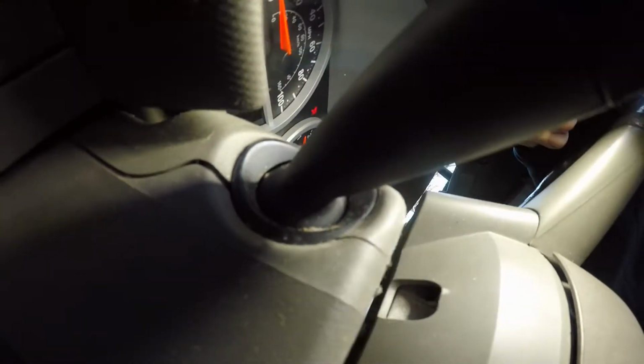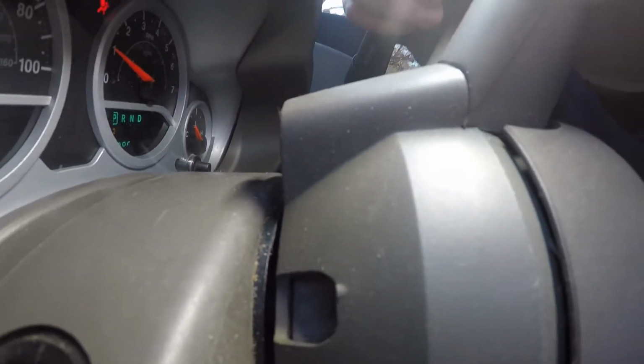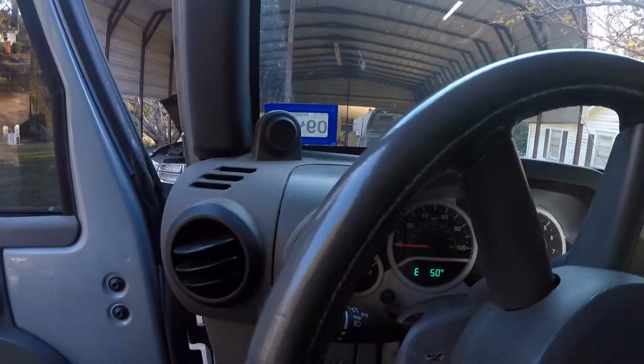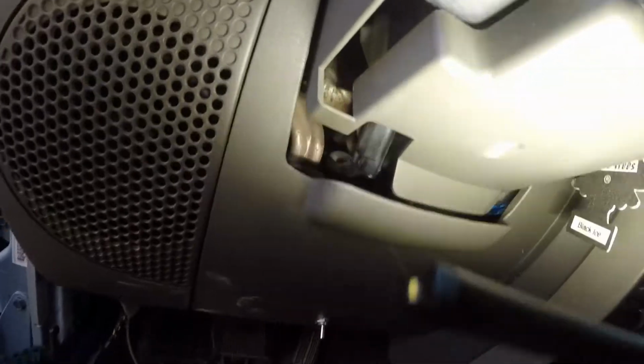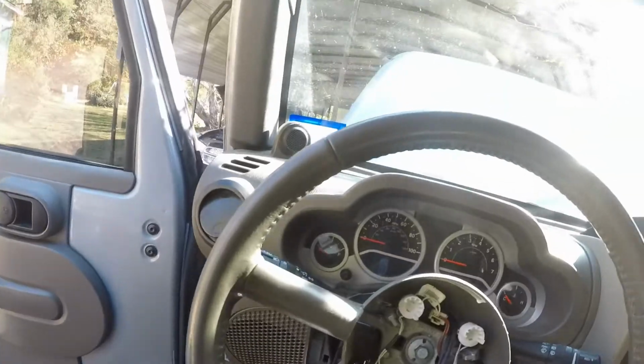And you'll stick your screwdriver in there from the back. That's the best you can do. I can't really tell you the best way for you, whichever way you think is best. But you'll have to pop all 3 of them off, this comes off, disconnect your airbag. Of course, be careful with an airbag, you know, it's an airbag. And then you'll have 3 bolts under here to take this off, and I'll show you what it looks like in just a second.